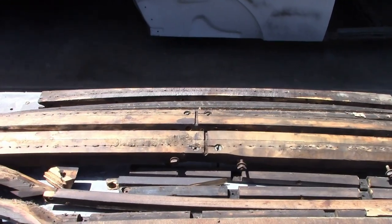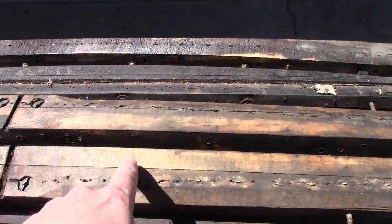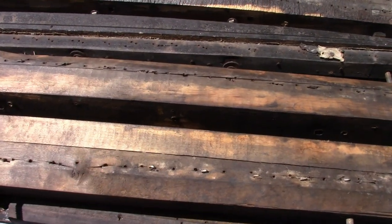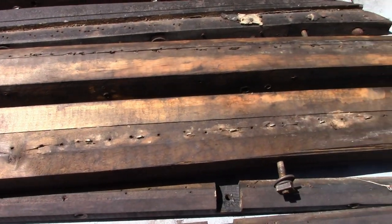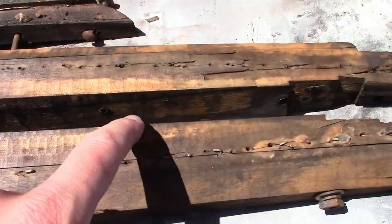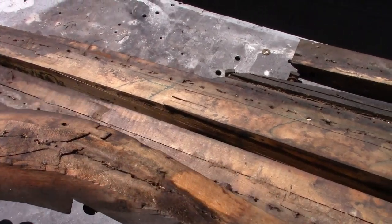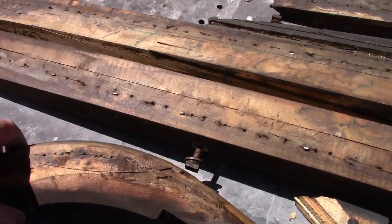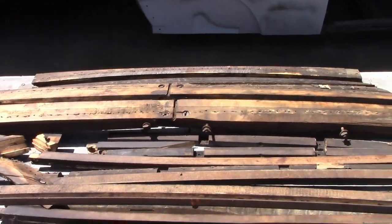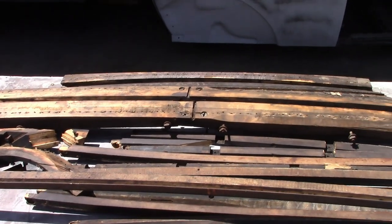Here's all the wood from the roof. Now these pieces, which were on the sides of the body — as usual, where they were glued together they're opening back up again, which is pretty common. And where the nails were, it's starting to crack open all across it. This corner piece here is really falling apart. Still, though, for an original car the wood is in surprisingly good condition, but not quite good enough to use — so we've decided we're going to replace everything here.